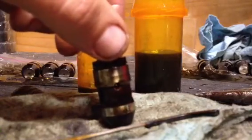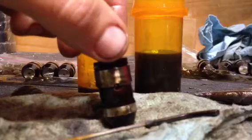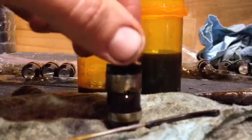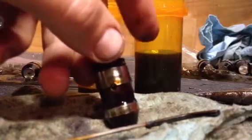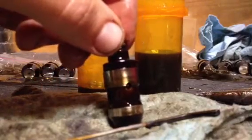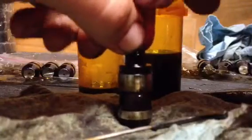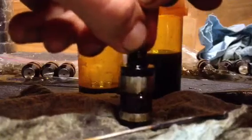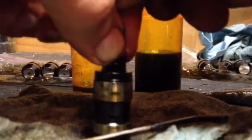When I put it back in a car, before I actually drop it back into the cylinder head, you're going to want to do the same thing again in a cleaner container of oil. You want to keep fresh oil in there. It doesn't really matter if you want to go a little bit thicker just to help prep it before the motor starts running — you can do like a 10W40 or something. It'll ensure that you don't have any air in the lifter. Get rid of all the old debris and oil. Now when I push down there's very minimal movement — this is one I just cleaned. Over here's another dirty one; when you watch me push, tons of movement. So it's gummed up.